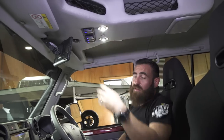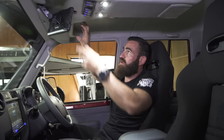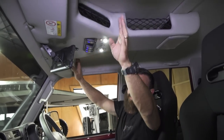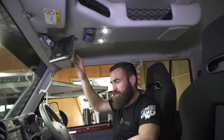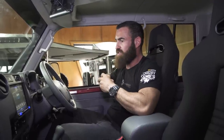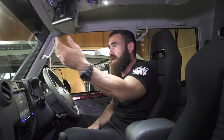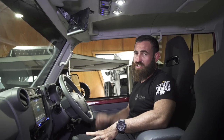There are reading lights in there, and all of your switches are up here activating all your lights. We also fit USBs and a cigarette socket into all of our overhead consoles — USBs for driver and passenger. For me it's all about keeping the cockpit as clean as possible; I can't stand seeing wires, so everything we put into the truck is hardwired in. The HEMA HX1 comes standard with all SuperToura builds — we developed this bracket a long time ago and it's hard powered into your car's ignition, so you turn the ignition on and the HEMA comes on, turn it off and it goes off.